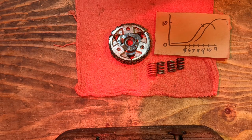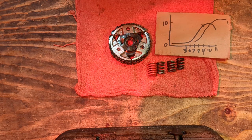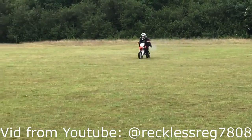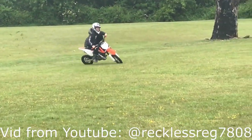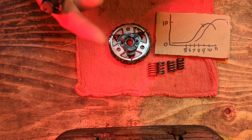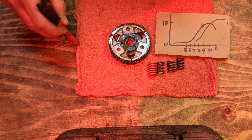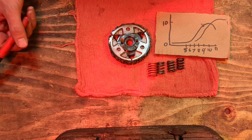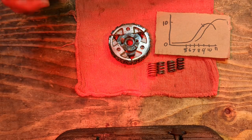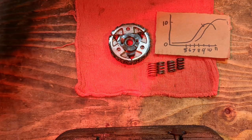However, if you have a newbie rider that also does not know throttle control and they're at a low RPM lockup, they will blow the tire off when they're going 10, 15, 20 miles an hour down the track. Because all of a sudden, the bike's going to hit a power band and it's going to instantly break the traction off. And it's going to get squirrely at high speed. Now, I'm of the mindset that it is safer to know throttle control and have your slip happen at a slow speed. I feel it's much safer if your tire slips at 3 miles an hour rather than at 20 miles an hour. But that's just me. I think it's better to teach your kid how to ride safely and give them the tools to do so effectively and let them learn from there.